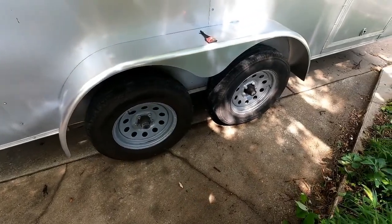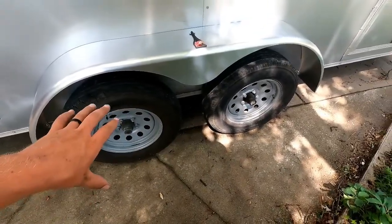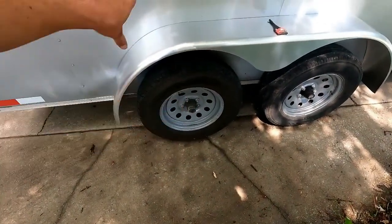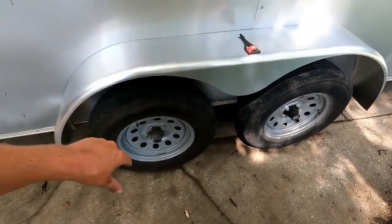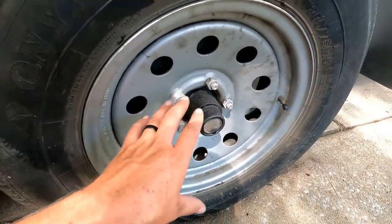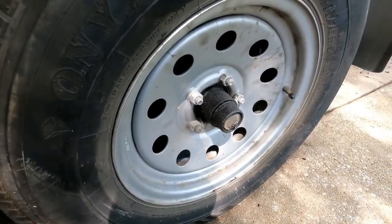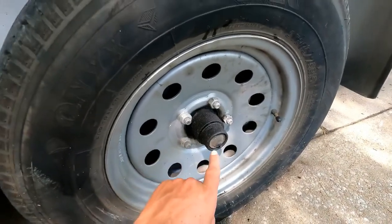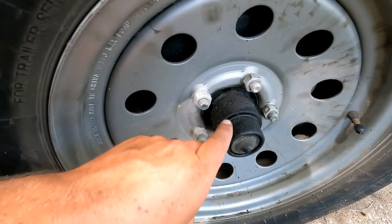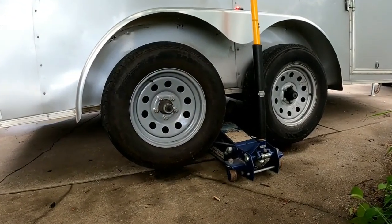As I mentioned in a previous video, this side of the trailer was involved in an accident — messed up the fender. We've already replaced that and fixed the light, and now we're on to the tires. We got some impact on the tires and got a flat tire; this is our spare. We're going to put on two new tires on the rear axle, rotate our tires around, and address this hub that's leaking. We haven't taken this to an alignment shop yet, so it possibly has a bent axle. We're going to take it to an alignment shop nearby and double-check that. But since this hub is leaking, we're going to go ahead and grease all of them — I think the grease has liquefied, and that's why it's leaking here, because there's no gasket on this joint. So we're going to do a little maintenance, grease our hubs, rotate our tires, and balance those out.